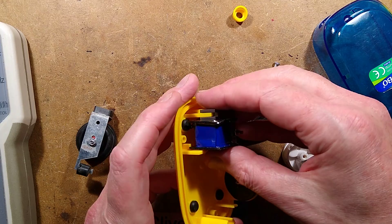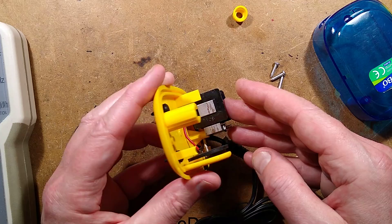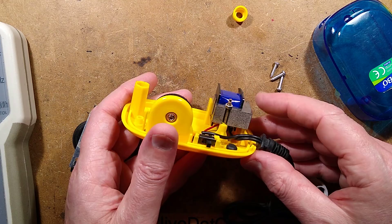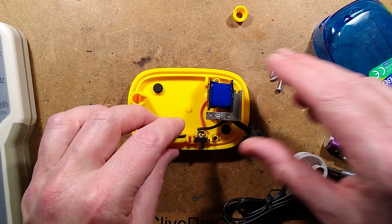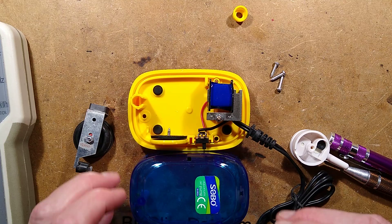That's the standard thing you find in these. They seem to use a standard coil — in some models that may even be universal for 120 volts — but in the European 220/230/240-volt ones they actually put a capacitor in series with the coil, and that's how they use just one coil for all variants. That's also a technique used in some time switches where they put a resistor in series with the coil, allowing a cheaper or coarser-wound coil. Nice construction; I do like the clear case. The air output adjustment is simply a diode in series, so it only operates at about half power.